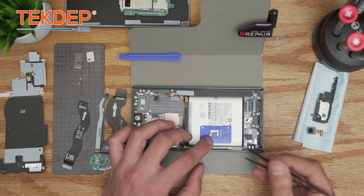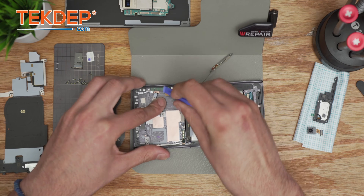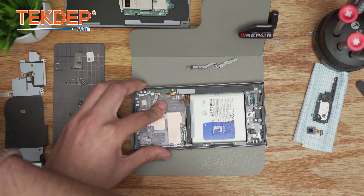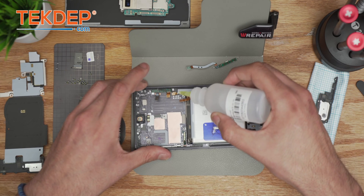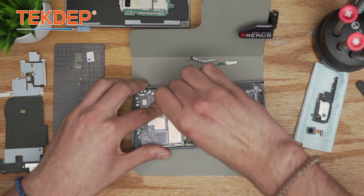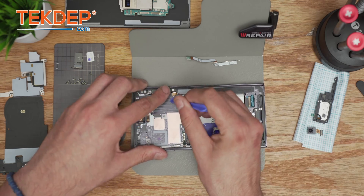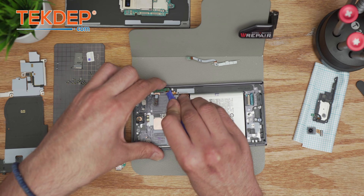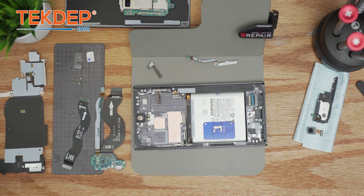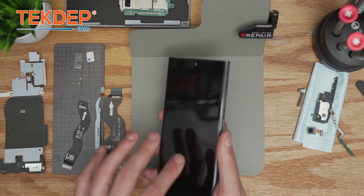There's a little bit of adhesive here. The way I like to do it: use a spudger for the adhesive and a tweezer for the lower one. Be careful because it's a flex cable connected onto the module — technically four pieces in two pairs. Don't put too much pressure. Alcohol won't ruin the part. I don't recommend heat on it since you can mess up the ribbon cable — just be patient. The solution should make it easier, and we even extracted the adhesive cleanly.